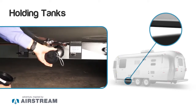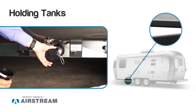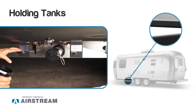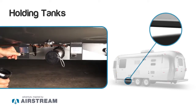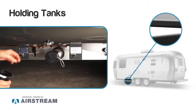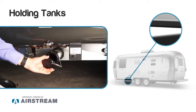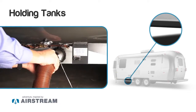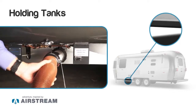And we're going to want to take off our sewer hose lid. We want to make sure that the dump valve handles are closed at that point. There are little safety clips on there to keep it from coming open when you travel. But you take this off, and then you're going to want to insert the hose end on there. Just give it a little twist. It's going to be hooked up.